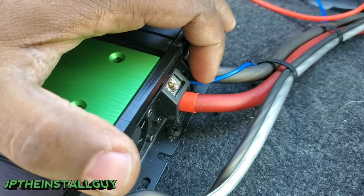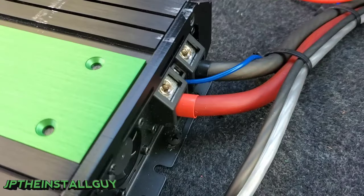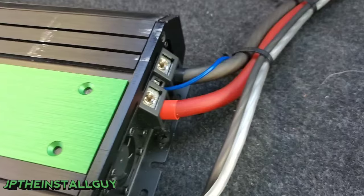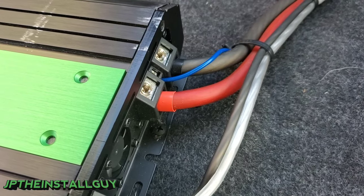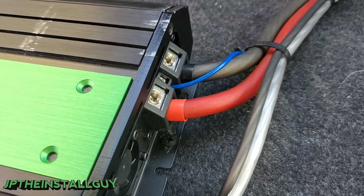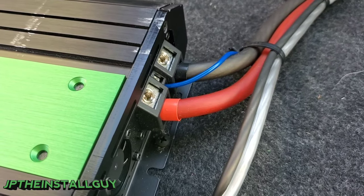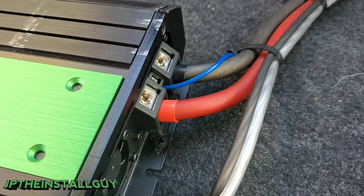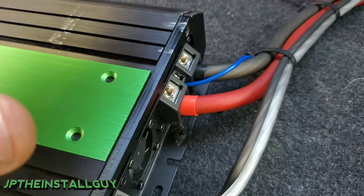But let's say your remote wire is the issue and you're not reading 13 volts to actually turn your amplifier on. Some things to check: where are you catching your remote signal from? If you have an aftermarket radio, you're probably running the remote straight from the back of the radio. If it's not providing that 12 volts, make sure you have a good connection — sometimes if you crimp too hard on a butt connector, you can be crimping down on the plastic instead of the metal, which can cut or partially cut the wire.